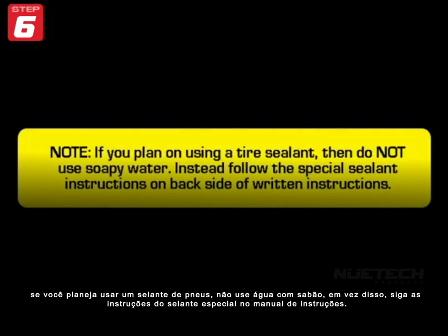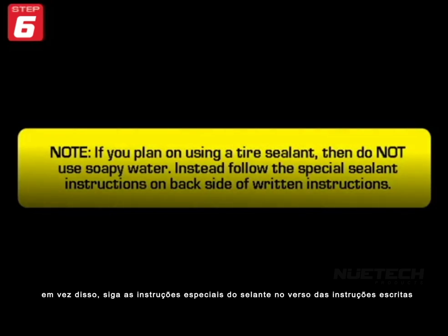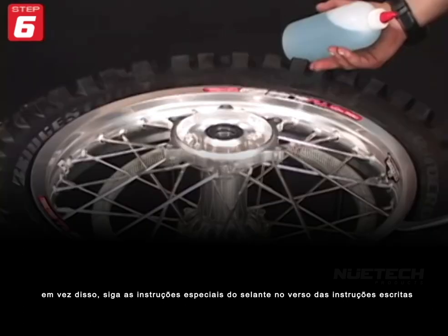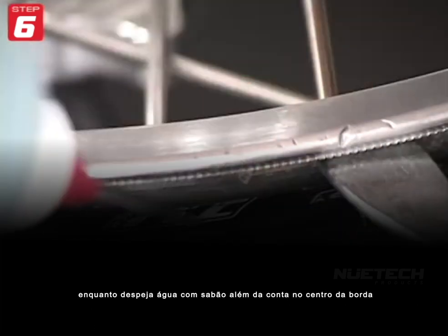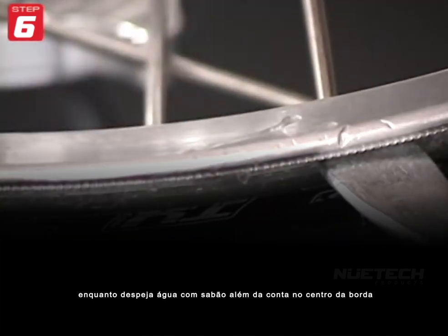For this step, if you plan on using a tire sealant, then do not use soapy water. Instead, follow the special sealant instructions on the back side of the written instructions. So let's start next to the rim lock. Pry the tire down with a spoon while pouring soapy water past the bead into the center of the rim.